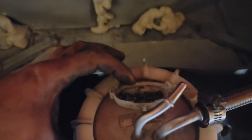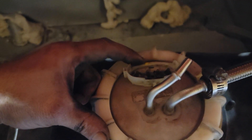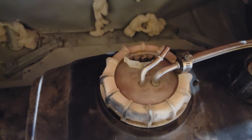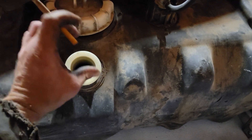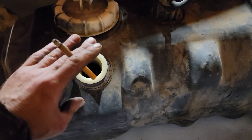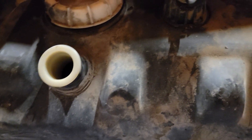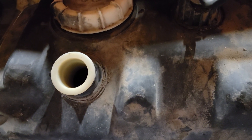I got the trunk marked up. This is the only pin that has a wire going to it - right here, see the mark is right there - and that goes to the float system for the fuel gauge. I still need to get a filler neck for this. I don't really need one but I'd like to, so I can put a cap on it. I'll probably go out to my junkyard and find one that'll work, cut it down short so I can pop the trunk and stick a fuel hose in there to fill it up.